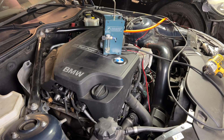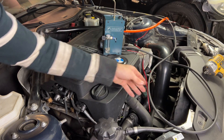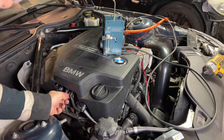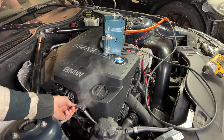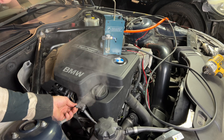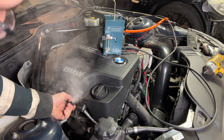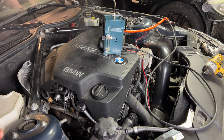Just to show you what a bad leak would look like — I have connected the smoke to a vacuum pipe on the other side, and what I'm going to do is just disconnect this vacuum line right here. See right there — if you see something like this, you have a big, big problem. Hopefully you don't see anything like that, and it's just a tiny bit somewhere, or you may need to change a gasket or tighten up a clamp — whatever it may be. This is a good way to find out.